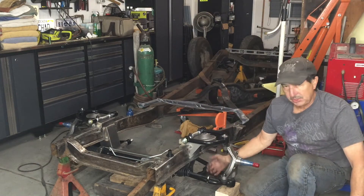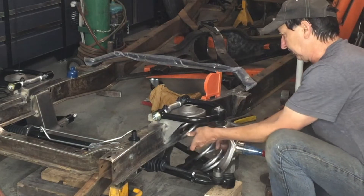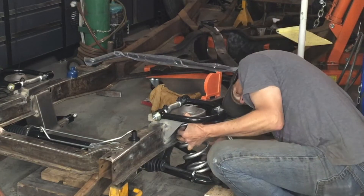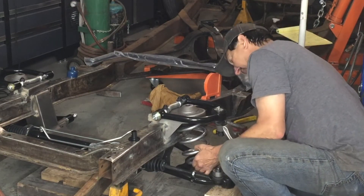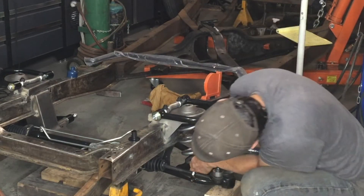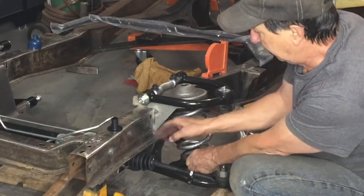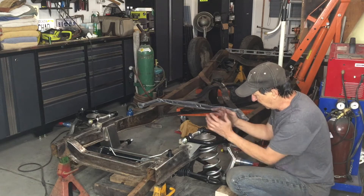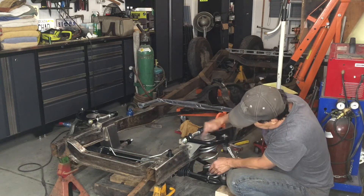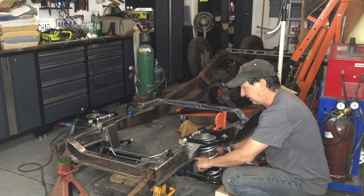Now I want to put in a shock and make sure the spring isn't rubbing on here. I have spring contact with the frame. So this flange that's sticking out — I'm a little worried about that. I'm going to have to radius back that flange. I'll have to put all the components together for the shock and check exactly how far back I need to cut this. I'll just radius it all the way back to the edge of the frame and then I can weld that pinch piece together, because it will cut out some of the spot welds.